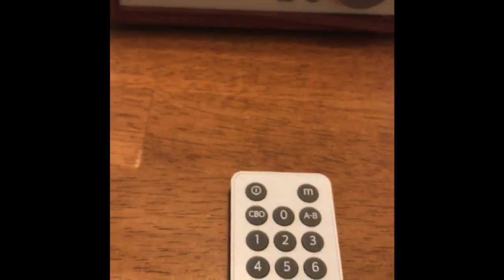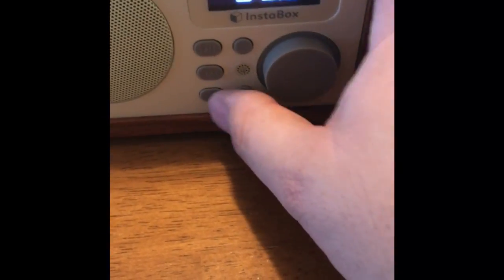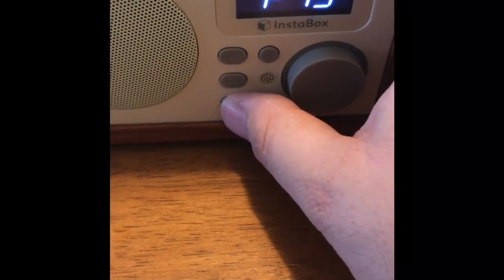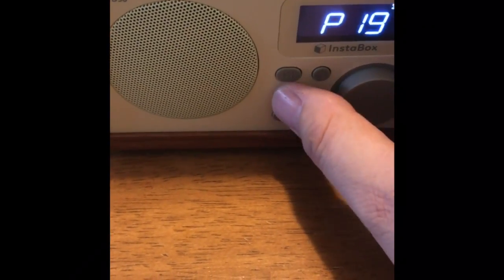So I'm going to go over the reset option in the back. When you push the reset option on the back, and you just do it by itself, you want to get something small enough to fit in there. The moment you push it, it shuts off. And that's just a basic reset. You turn the radio back on, the time's still set, and we go ahead and switch to the FM mode. And all of our channels are still set. This might be used if you're playing an MP3 and the corrupt MP3 locks up your radio. You might need to do that soft reset.